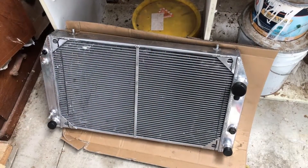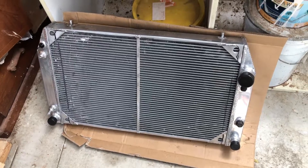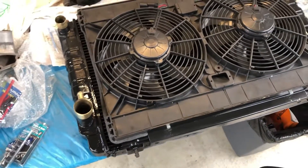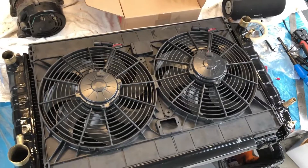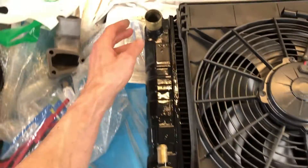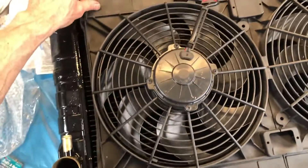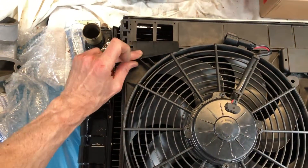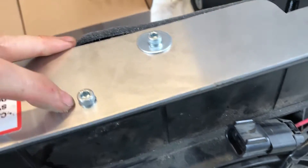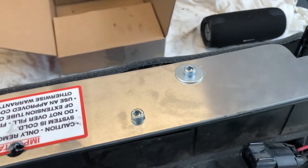In the end I went against using the aluminium radiator — it was just going to be too much work to modify it to replicate the original. This is the original radiator; it's been reconditioned. The electric fans have been mounted onto the radiator. The guy who did the work did a great job of renovating the original — he re-cored it — but he put the fans on upside down, so this is the correct way up in the car. He also put on some bolts onto the top that stick out too proud, so I can't get the panel that sits on top to fit, and I'm going to have to replace them with countersunk bolts.